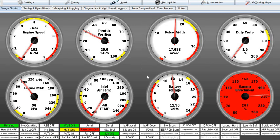We go out and take the spark plugs out of the engine, and we hook a timing light up. Before I do that, I try to find out if there's an existing top dead center mark on this engine somewhere. Get the engine to top dead center for the number one cylinder, and then somewhere convenient where it's easier to do, like the fan housing on the top, make a mark for 0 degrees top dead center of piston one. Then, with the spark plugs out, we will crank the engine with the timing light and observe that mark.